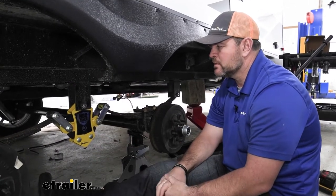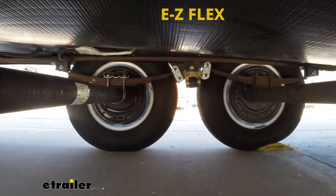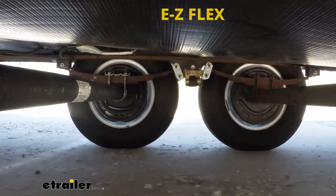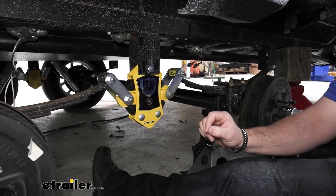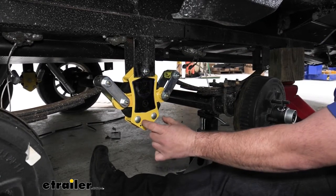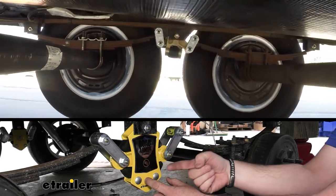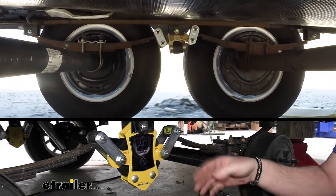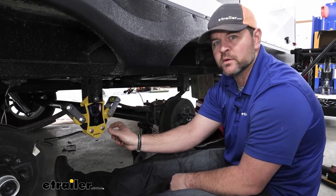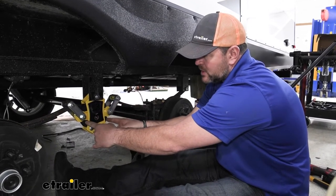Let's compare this to some of the other types out there. One of them is the Easy Flex, which is also designed for a tandem axle trailer and handles up to 8,000 pound axles. The difference is that with the Easy Flex, you have an arm that comes off your spring on each side with one rubber boot right in the middle. It will reduce the chucking and vibration, but you only have one boot in between. With this one, you have four — one on each side on top and one on the bottom on each side.